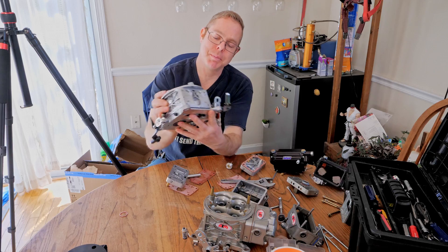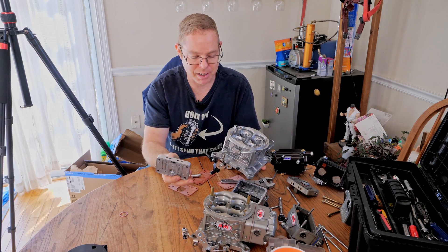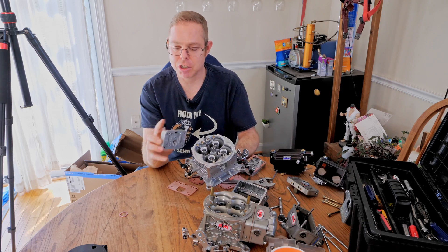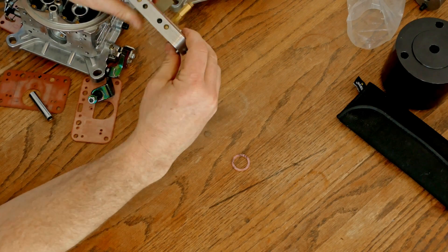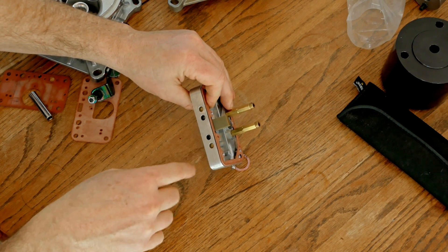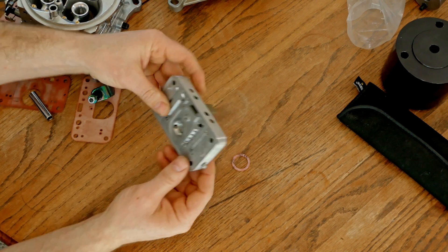That's pretty much the whole premise of a blow-through carburetor. There are a lot of things I didn't cover — I'm not a builder. These passageways all have to be a certain size, and that's where the smart guys come in. This is probably where Kevin drilled the larger passageways for the ethanol that go down into the main well. He also put glue or adhesive in here because when pressurized, the normally pressed-in seat can actually leak fuel out. So the adhesive makes sure no fuel comes flying out the top when it's pressurized — that's also an important modification.